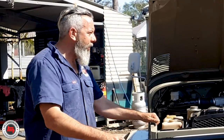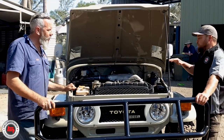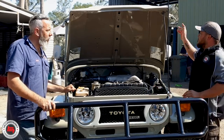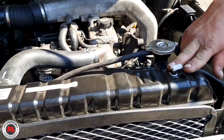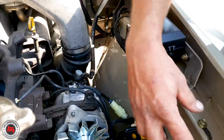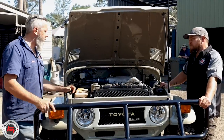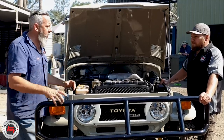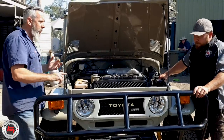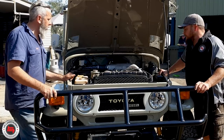There's something exciting we do now — the wiring. Full wiring loom, front to back, with all the bells and whistles. He's gone above and beyond: two sets of spotlights tailed up ready for fitting, a light bar, work lights, low water alarms at the top of the radiator, and a lot going on in the tray with battery systems. Power runs down inside alongside the tunnel to the rear wall where he'll have his compressor. These 40 series looms are now all custom — instead of just selling a HJ47 2H loom, that's had its day. We do new ones, but there's a questionnaire: do you want this light, do you want something at the back? There are extra options, so you're not chopping into stuff. Absolutely awesome.